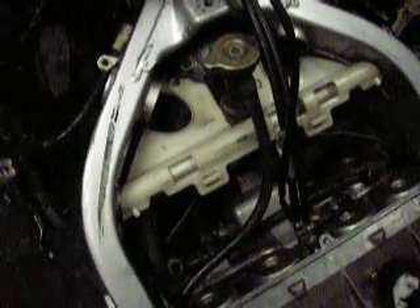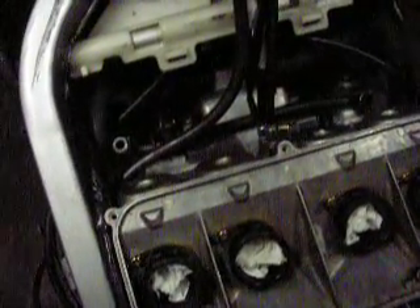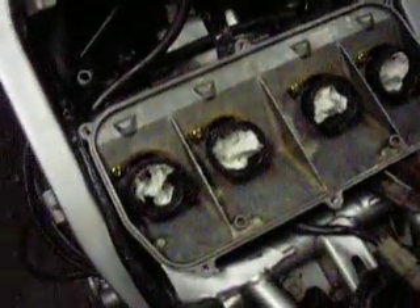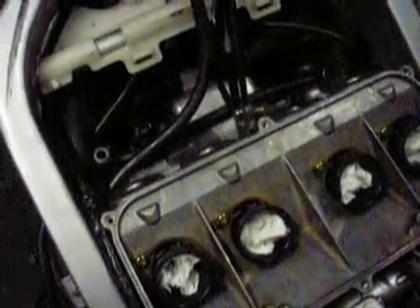Position the carbs next to your intake holes, then put your fuel line on if you have a fuel pump — it's easier that way. This one is very tight to get the fuel pump hose that connects to the carburetor, so it's much easier when the carbs aren't on the engine yet.